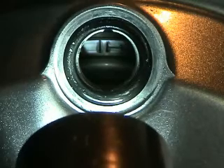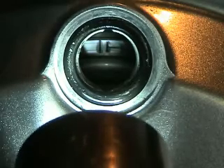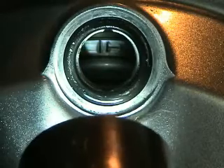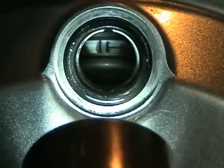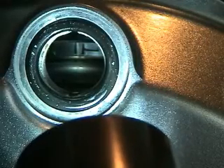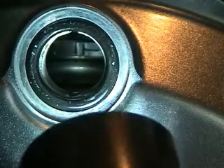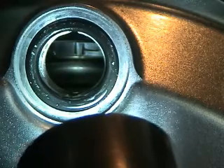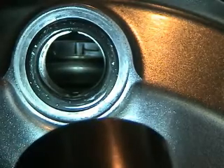The mark you're looking for is on the left side of a T — the T is rotated on its left side as seen here. With the engine on a compression stroke, the piston should be all the way up and the valves should have some free play. This free play is what needs to be adjusted.